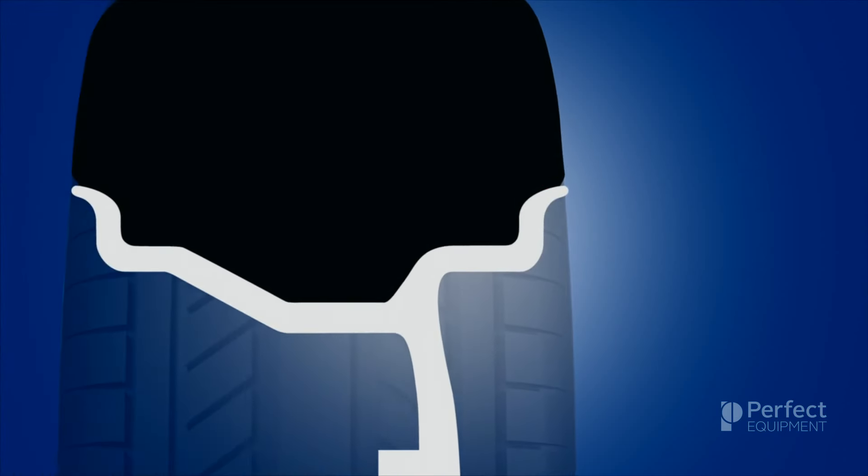If we zoom back out, we can now learn how to incorporate these wheel weights to achieve perfect balance. We can see in this example that the wheel features a rim flange and a rim spacing area on the outside and inside of the wheel. When balancing a wheel with inside and outside flanges, it is best to place a knock-on wheel weight on both sides of the wheel at the location of the imbalance. This is the most commonly used balancing method. In the event that there are no rim flanges on the wheel or knock-on wheel weights are simply not desired, applying adhesive weights on the inside and outside rim spacing area can also accomplish perfect dynamic balance.